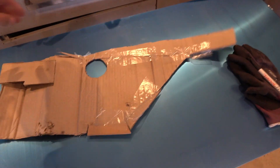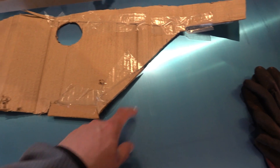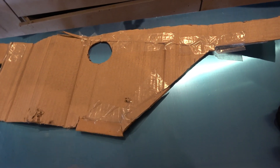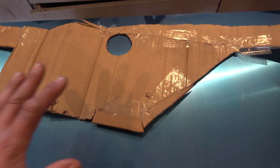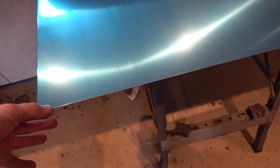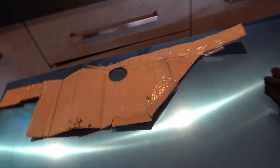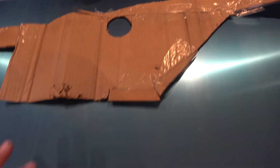Let's just get this traced and start cutting some metal. I have the rough shape of the airbox that I want to make, but it's not really traceable directly. So I'm going to transfer this rough shape onto some finer, thinner cardboard that I can then trace onto my sheet of metal — in this case a two millimeter thick aluminum sheet — then cut it out and bend it accordingly.